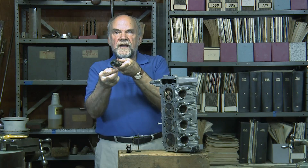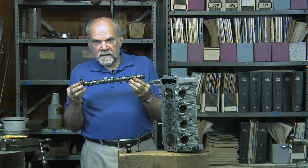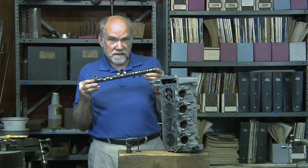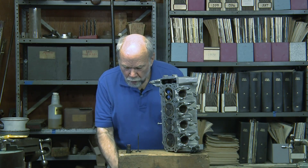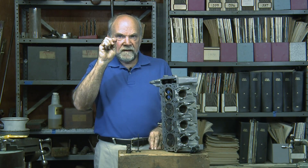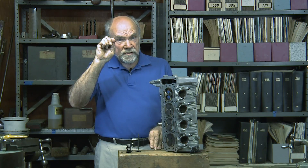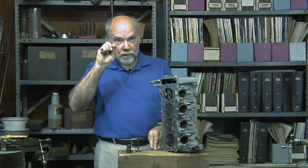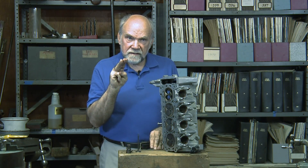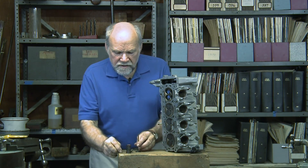The pressure of the spring compels the valve to follow the motion that is ground into this cam lobe. What's quite wonderful is that at peak RPM, each valve is opening and closing 113 times per second. The whole process — initially lifting the valve, accelerating it towards open, decelerating it to a stop at the top of its lift, then reversing its motion, being driven towards closed by the spring following the cam lobe — that process takes three thousandths of a second.